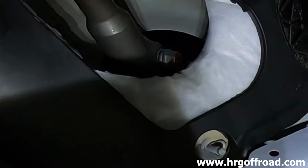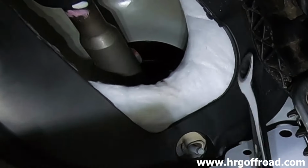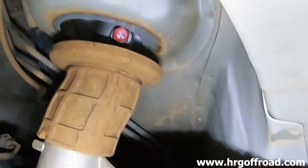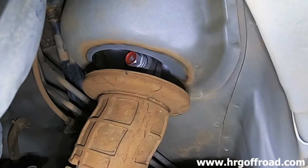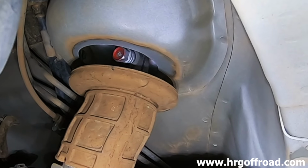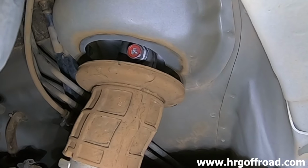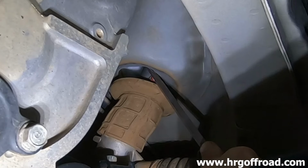Yeah, just turn it and it'll self-adjust a little bit. All right, now we can tighten it back up. It's gonna allow it to drop. It should press off of the rod. Exactly. So we're making contact right there, just ever so slightly. So the fix for that is gonna be to bend that metal out of the way just enough to where it doesn't contact. Like rolling fenders.